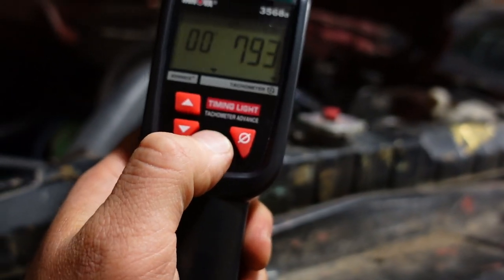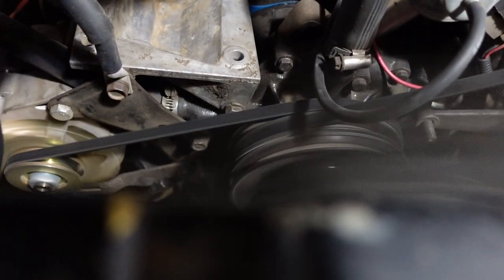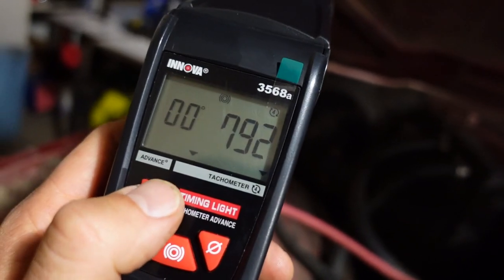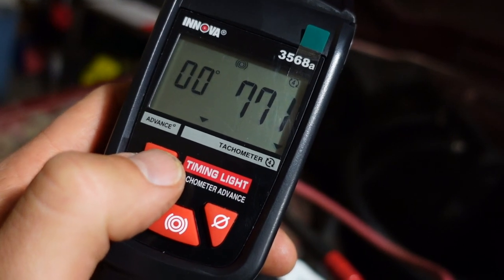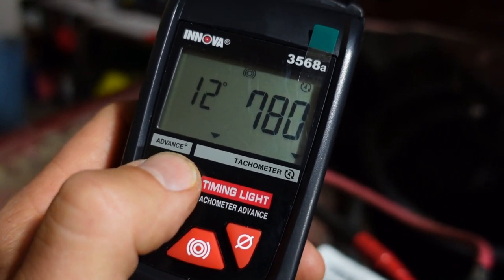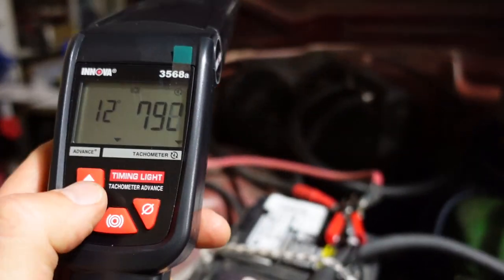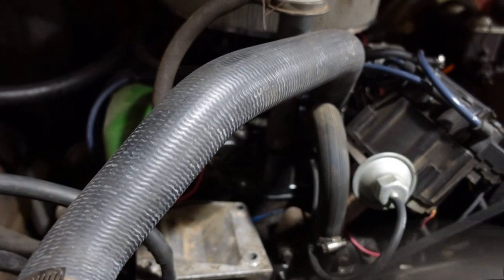This button right here is how you get the flash to go. Turn the RPM up in there — I don't know if you can see it down there. So I just figured this out: you can set it to where you want it to be. I know that right now I'm at 12 degrees. If I set this to 12 degrees, then looking at the harmonic balancer it should be at zero — and it is. So that's awesome. Super easy to set up. I know you can't see the timing mark down in there, but I can see it — it's just hard to show on camera.